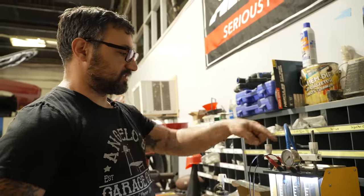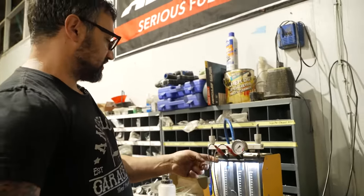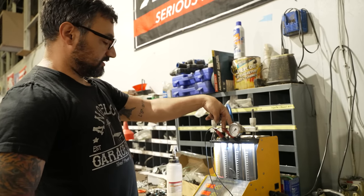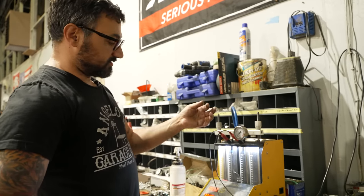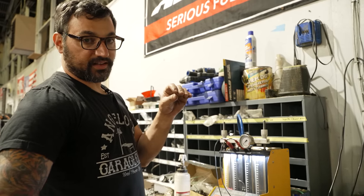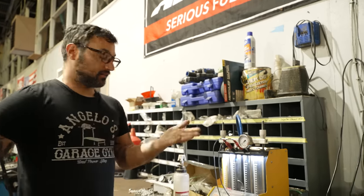This is some science. So essentially, this is like a little fuel rail. It's gonna feed these two injectors. He's got plugs in the outside ones, two at a time. And it's feeding them fuel pressure, and then this is gonna open them. They're just big magnets. You just energize them. When cars are controlling the injectors, they give them a pulse width. That means how often per second they're opening them. Bang, bang, bang, and sort of letting them go.